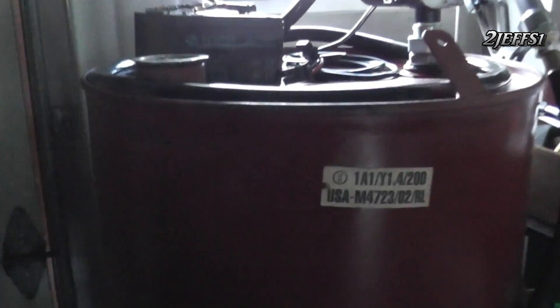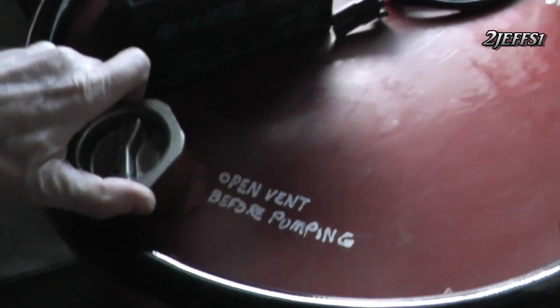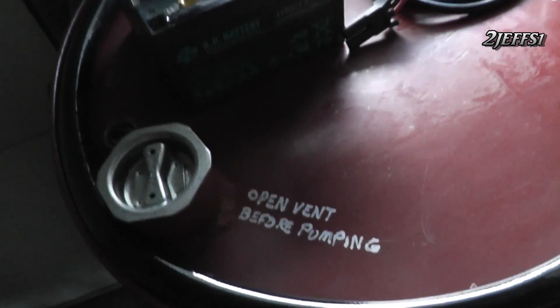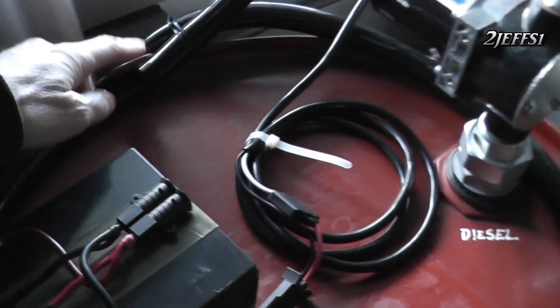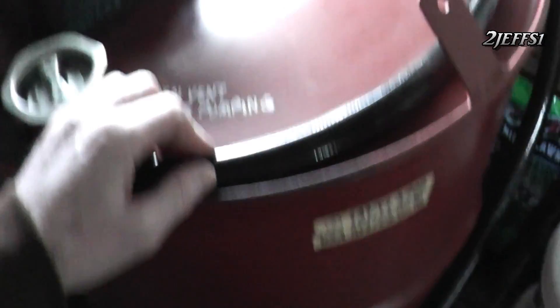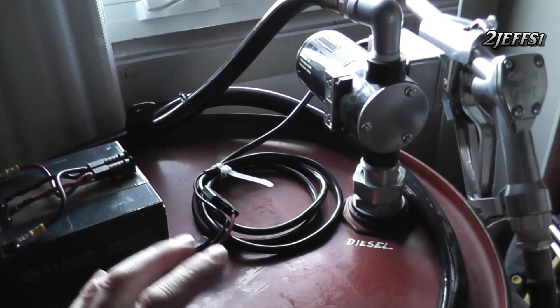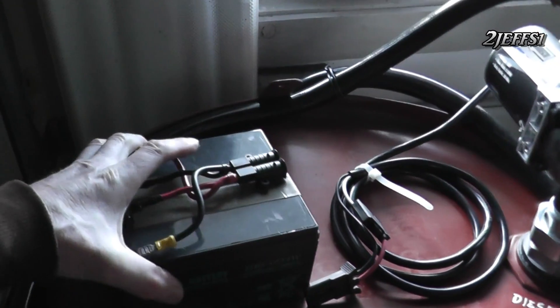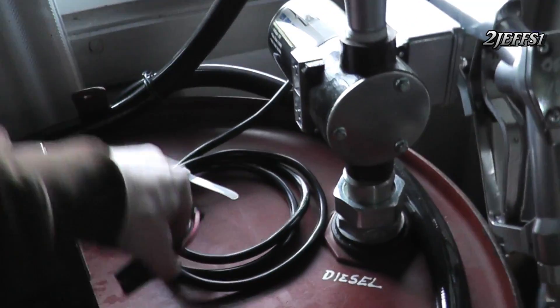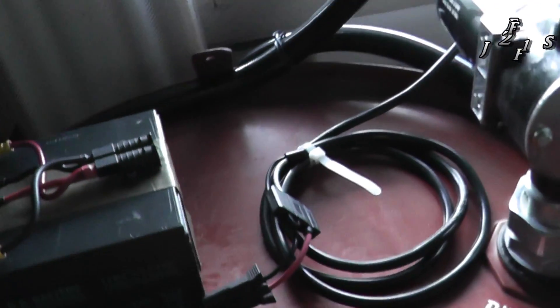If you want to see what those batteries are normally for — this barrel is full of diesel fuel. I welded a bung in here to fill it at the fuel station, then I got a chain across it so I can use my air hoist to set it in the back of my truck or take it out, and of course there's a dolly to roll it around. What's handy is I can go out to the Case tractor with fuel already in my truck, and I already have power to run the pump. This plugs right in where I had those batteries in parallel, so they run a long time on one charge.